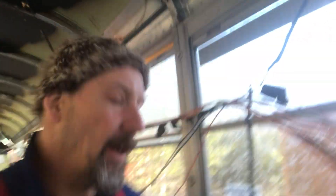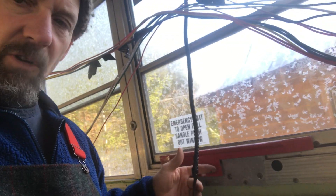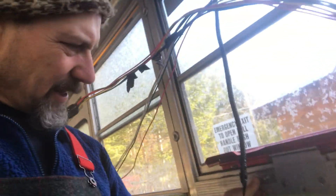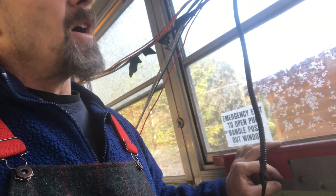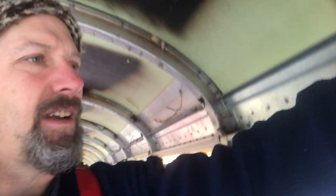One thing I noticed — I had some buzzers going off, and this emergency hatch here didn't close really well, and it kept having that buzzer going off. So if you're having issues with buzzers, double check to make sure that these close up right, because that switch right there pushes in, and if this doesn't latch really tight then that buzzer goes off. I'm going to double check — I'll do the same thing and restart the bus to make sure everything works right.